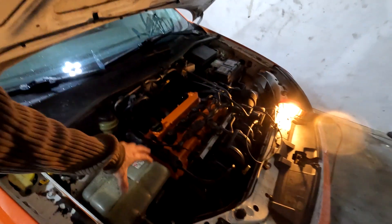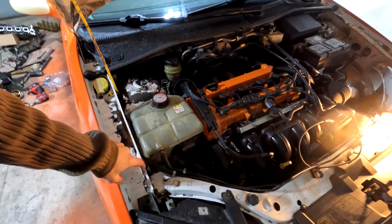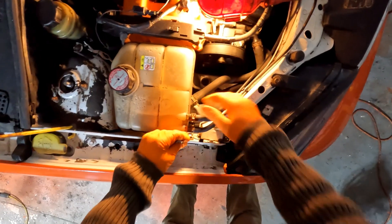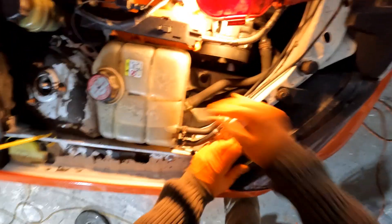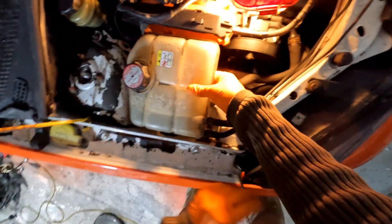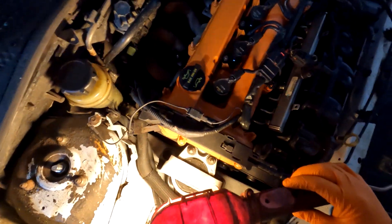On these, it's really kind of a pain to get the belt off. You actually have to pull this — it's an 8mm right here — and that lets you get at the idler pulley, which is way down in there. That's actually a 10mm, and it's the only thing holding the coolant on besides the clip. This back here just pops up. That is your idler pulley down there — it's the farthest one down and the farthest one left. It's a real pain to get into.